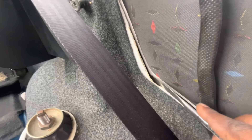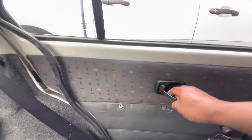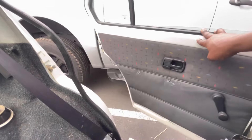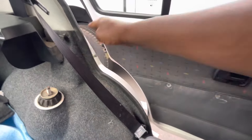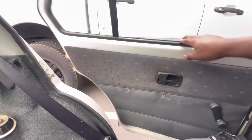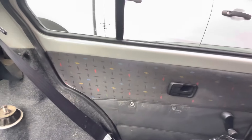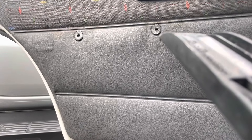Let's see if the door opens — and voilà! That's all I needed to do. I didn't even need to open the door panel. This could have taken just 30 seconds. The door opens! So guys, this is how you do it: if you're stuck and want to disable the child lock and your door handle is broken, that's all you need to do — 30 seconds. Remove that rubber seal that protects water from getting in, move it toward the door mechanism, and that's it.